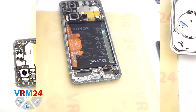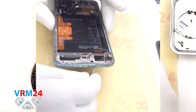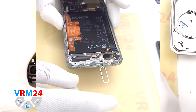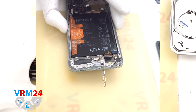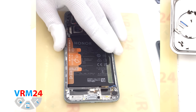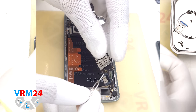In the display frame we are left with the fingerprint sensor and the vibration motor. Here is our usual quick test of the microphone opening. The microphone hole is located in the display frame, has an L-shaped form, and is protected with a gasket from the inside. If we insert something into the microphone hole, we can't damage the microphone itself because it is mounted on the subboard on the other side of the hole.